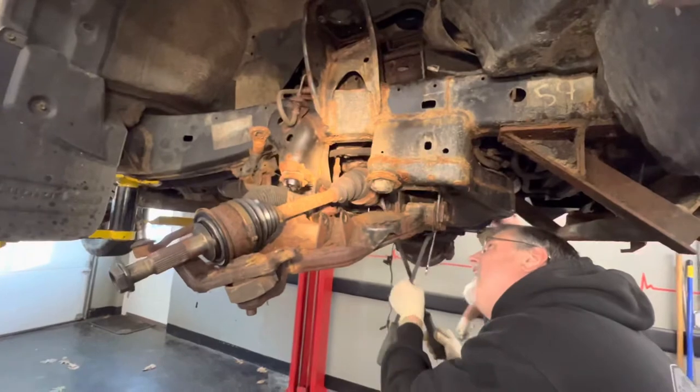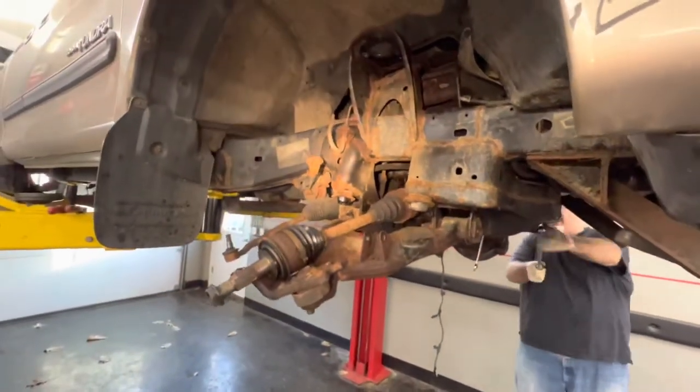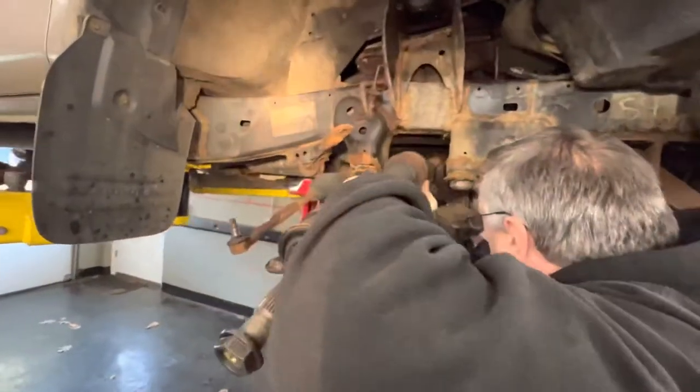Again, if you were just doing the axle, the A-arm typically would be connected up here - you could swing it up and out of the way and sneak out the axle. We've got a little pry bar in here and we're going to see if we can get this thing to pop out. The rust is holding it. We knocked half the truck on the floor - here it comes.